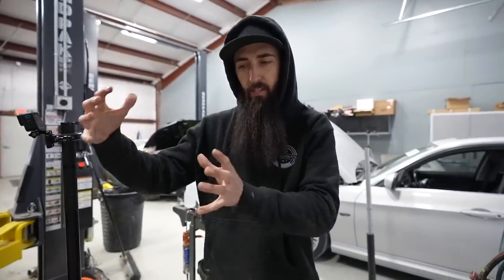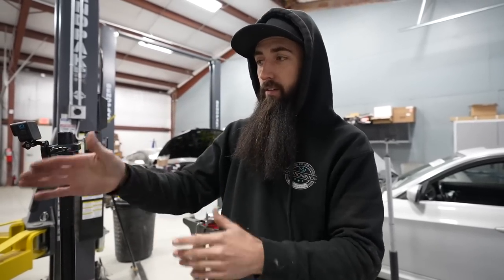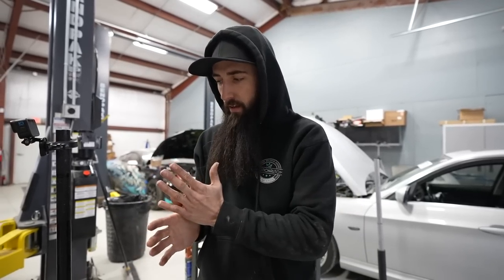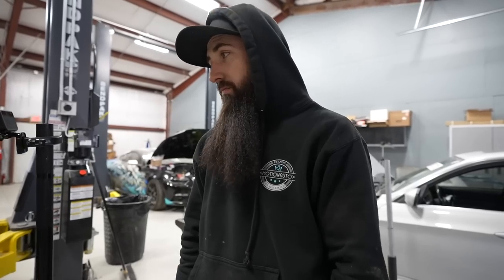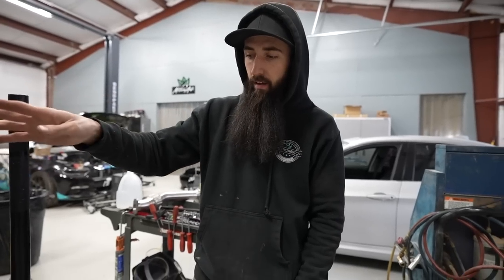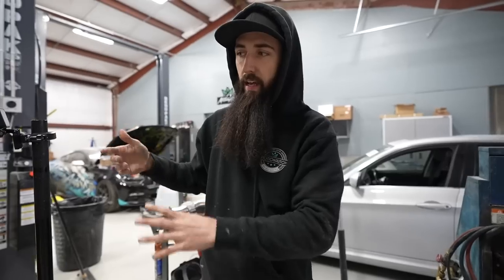Part of the AC compatibility is mostly for the placement, to get the turbo out of the way so you can run a downpipe because of the AC compressor. There's no way you'd be able to run a turbo with that factory thick radiator shroud, so no matter what, we're going to have to do a pusher fan in the front of some sort, and then potentially reroute the lines and move them around. Garrett has messed around with hardlining some AC stuff before, so we'll mess with that. For now, technically, we could move the AC stuff out of the way, make a downpipe and the other stuff, and then put the AC lines in at a later date, charge the system, and all that. And I'm excited to get this thing.